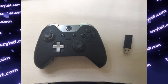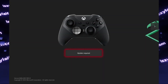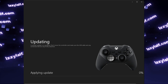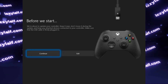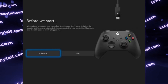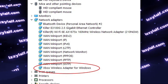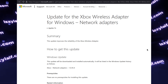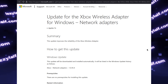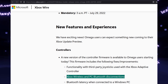This is exactly where we're having problems. When you connect an Xbox One controller to your PC using the Microsoft dongle, it gets randomly disconnected. The first fix: use the Xbox Accessory app for Windows to find and update firmware for both the receiver and the controller itself. To upgrade controller firmware, connect it via USB cable to your PC. Note that Windows considers the Xbox wireless adapter a networking device, and some updates come through Windows Update, so make sure Windows has all the latest updates installed — this often solves the wireless connection issue.